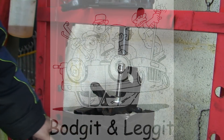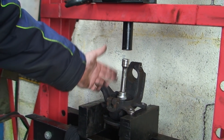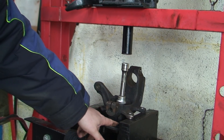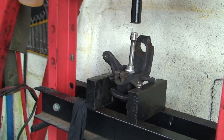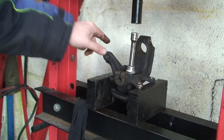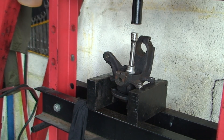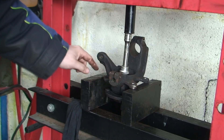I've got it as flat as I can. I've got a little extension bar - it just saves me lifting everything up. Now hopefully the stub axle, which is just down there, is going to come out. The problem is because we had problems getting the CV joint out, this could be exactly the same problem. I was lucky getting that CV joint out without causing any damage. Now the pressure is just on that.